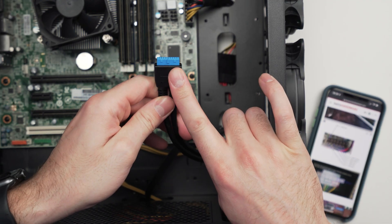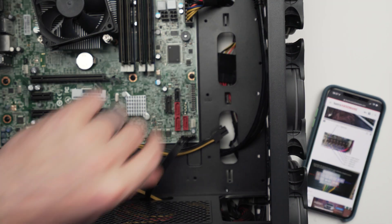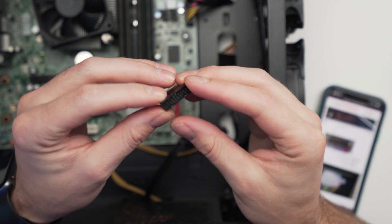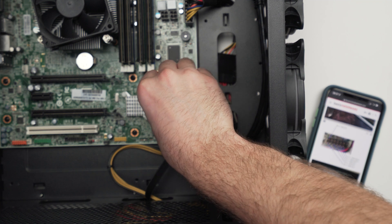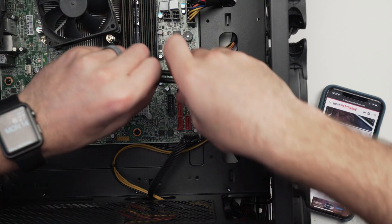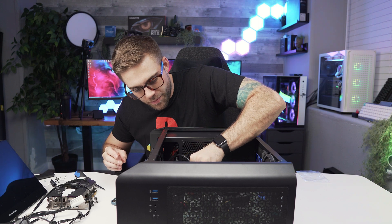Now I want to retain the USB 3 ports that were on the front of the Lenovo M93P. This case also has two ports just like the M93P did. Using the cool little connector from Hairbin Repairs - link will be down below - we just match it up with the slot we took the connector out of and slot it right in. It basically converts that proprietary connector into a standard USB 3 connection. With that slotted in, we take our USB 3 cable and plug it right in - and now we have USB 3.